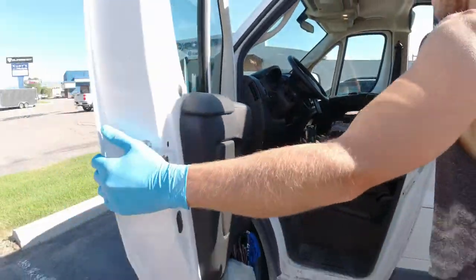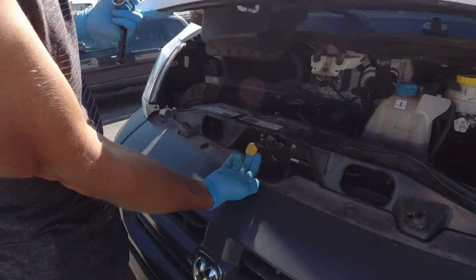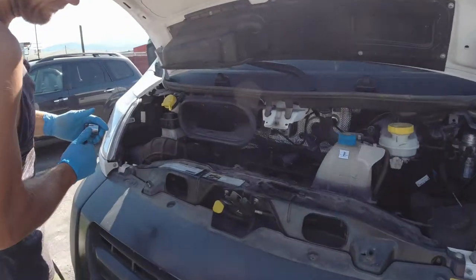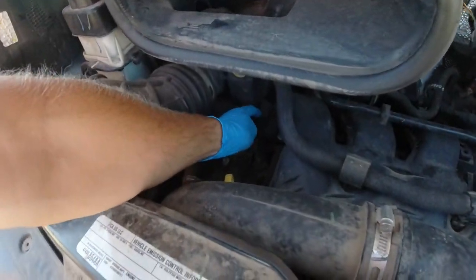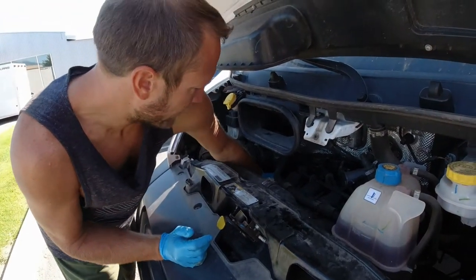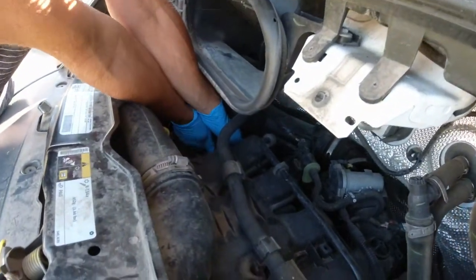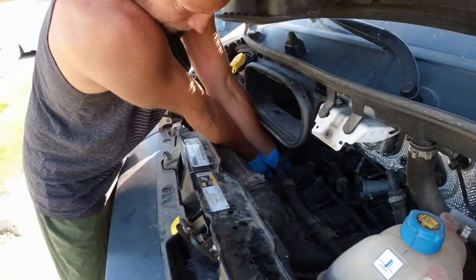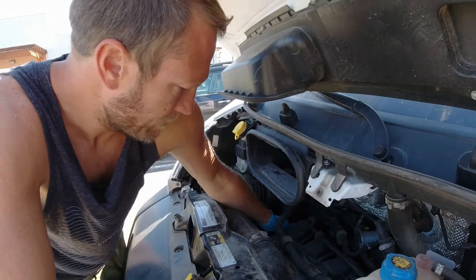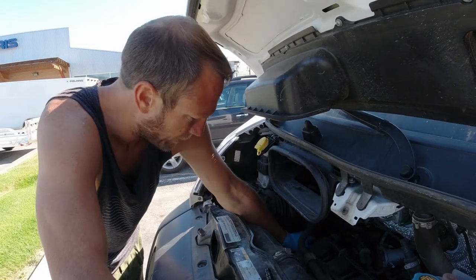While it's draining, go ahead and pull out the oil filter. Release your hood latch which is inside the driver side door, come around, and there's a little latch to pull up under the center. Lift that, put the support into place, and then for the oil filter you're gonna need your little shorty wrench — it's inside this housing down in here. First time I did this I was really bummed about this location because it's kind of small and tight, but now that we've done it a few times I actually prefer this over old-school oil filters.